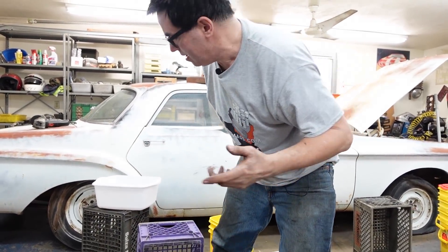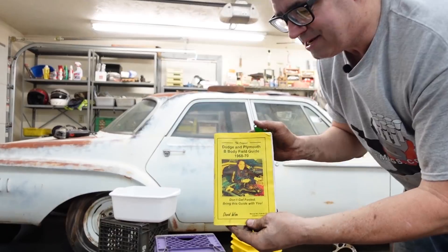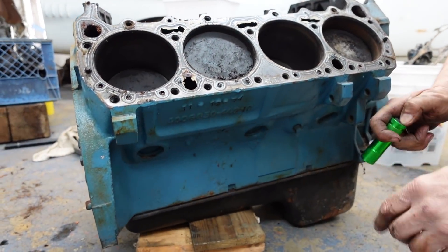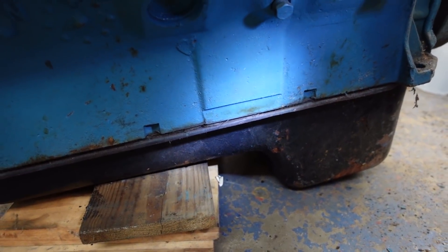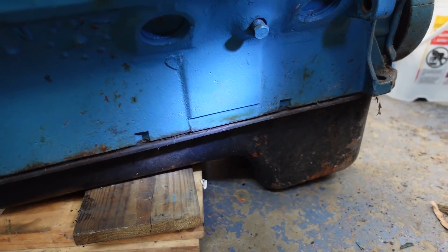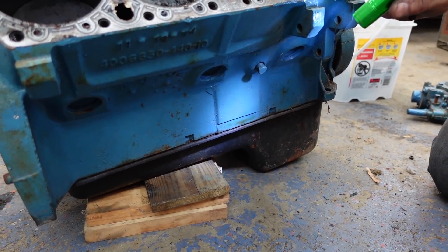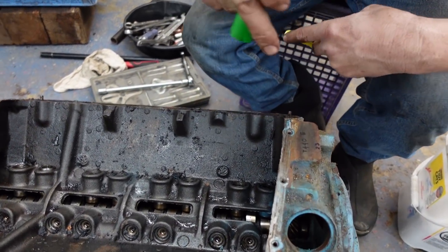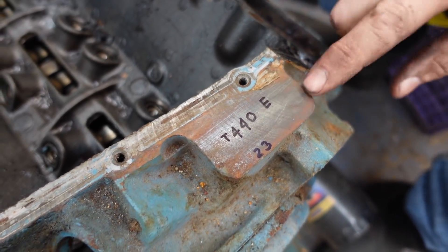Let's learn a little about this block. There are a couple of places you can look to see what it's made of, and I like to use the Dave Wise MMC Detroit decoding book for that. Down low on all engines from about 1968 on up, there's a machined pad that generally has the VIN and related information. This one has nothing, which is actually not uncommon for truck and van applications. The raised pad on the front of the block is something you find only on 413, 426, and 440s, and a handful of 383 raised decks.